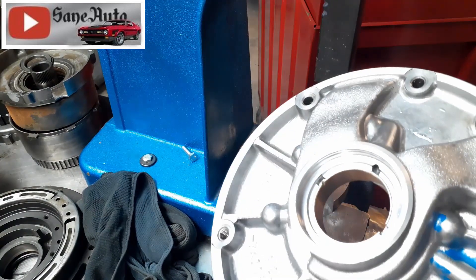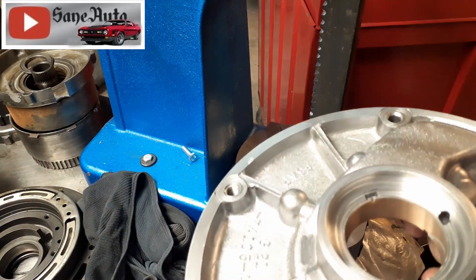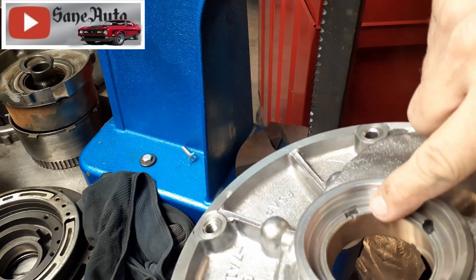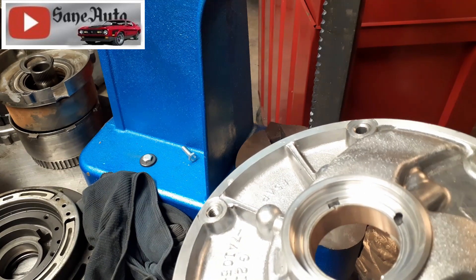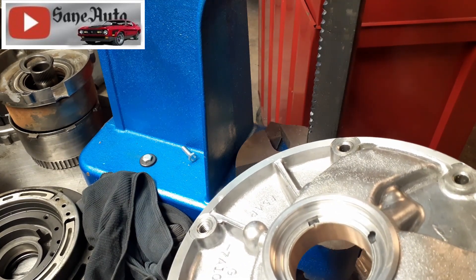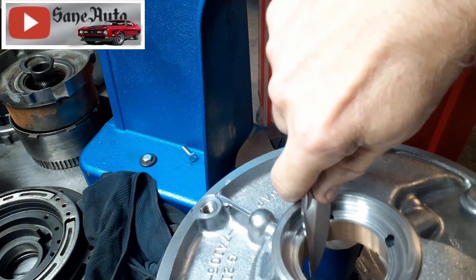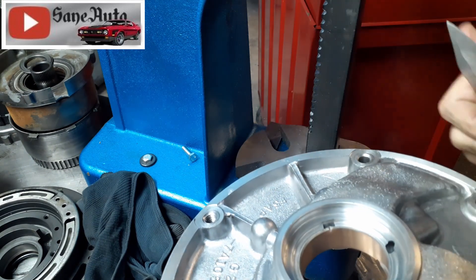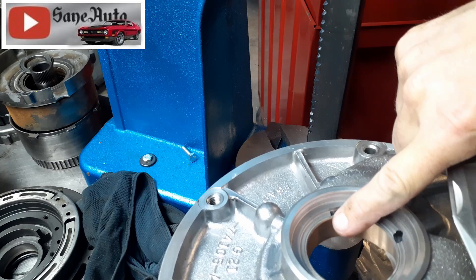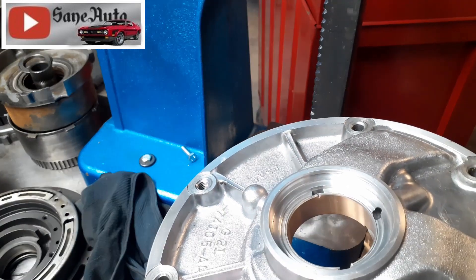There — did you see that? It moved just a little bit and I could feel it hit that other bushing driver and stop. Now we've got just a little bit below the surface — we know the gear is not going to touch the bushing and it's perfectly lined up with the outside edge, because the stop prevented it from going too far. Here's a beat-up old flathead screwdriver I use for staking. Take a look at how that looks now that it's staked.